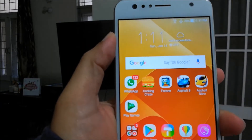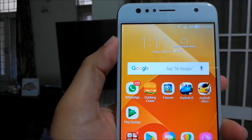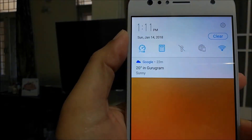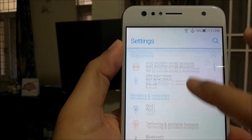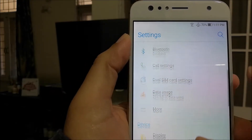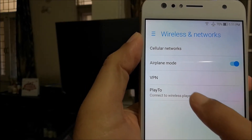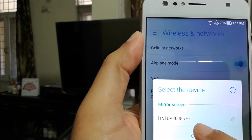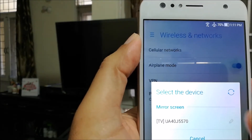How to do the screen mirroring — make sure you have a smart TV and a Wi-Fi router, and that your phone and TV are on the same Wi-Fi network. So we will go to the options here. I click on Settings, then go to More, and then go to Play To. Now if I click on Play To, it's showing me that it can detect the TV.